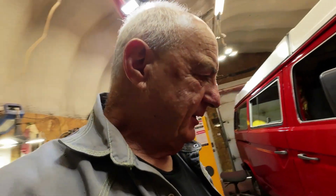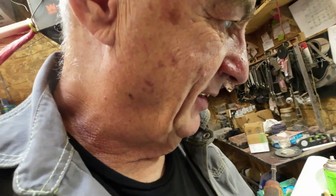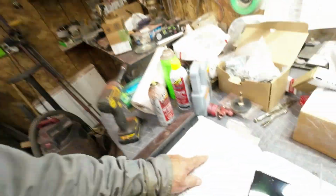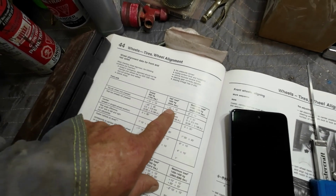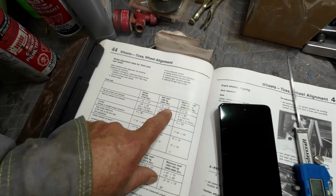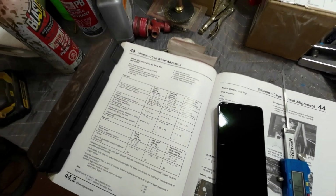Yeah, here I am back at wheel alignment. Boy, oh boy, I get things backwards and upside down all the time. So anyway, yesterday, as I was going through editing, I noticed that these things are toed in by about 2 millimeters too far, but I'm going to check that with my mathematics here, because I finally figured out my mathematics on this thing. So toe in per wheel, like 10 to 15 minutes, right? Per wheel, 10 to 15 minutes. So I'll just check the math on that, and I'll get back to you.